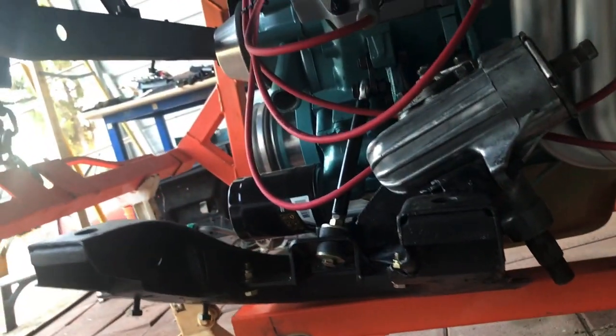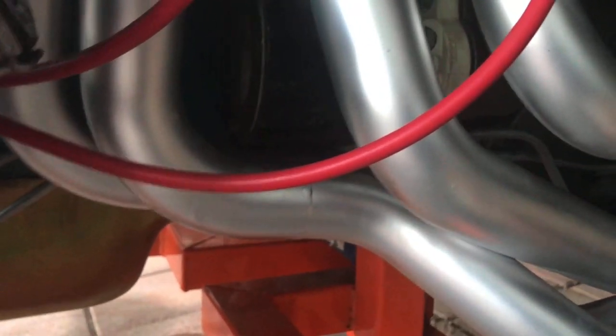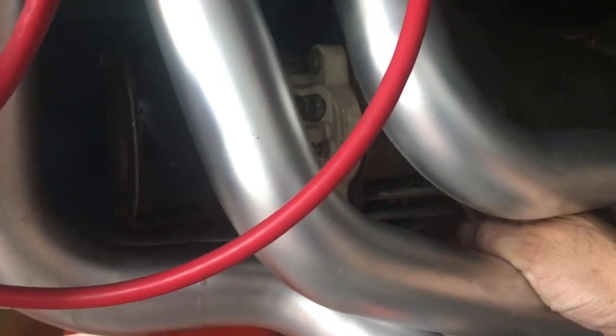So next thing to do is to get the car down to the K-member. So see, there's the frame rail, there's the K-member. Get this guy down here, bolt up the K-member, bolt in the trans mount, and then the car will be holding the drivetrain, and then I can pull this dolly out, that bracket off. I can tighten up the headers to see where their final resting place is gonna be, and then figure out the trans lines, tweaking them and bending them so that they do not hit the headers. That's where we're at.